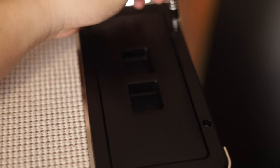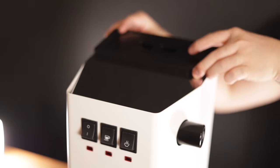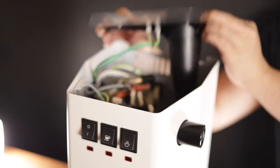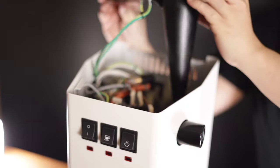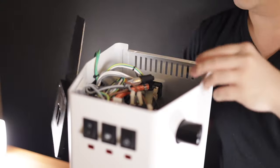The first thing you're going to want to do is unscrew these two screws on the top of the machine. You don't have to unscrew it all the way, just enough for it to get loose so that you can lift and pull back the top piece. Underneath this top tray you'll see a cone shape — that's for filling up the water reservoir from the top — as well as two wires. You can unplug these easily, but I kind of just let mine dangle off the side while doing this mod.